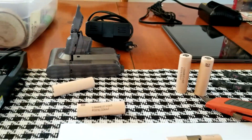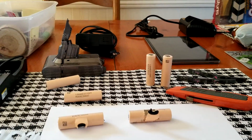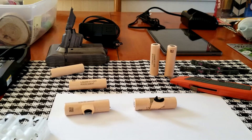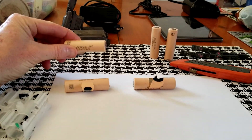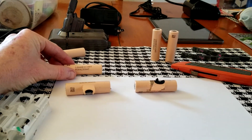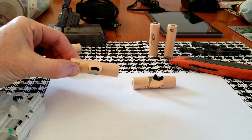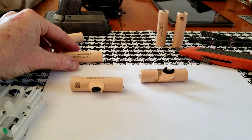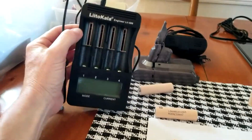The other four cells are looking absolutely fantastic — no visible damage. The reason people get rid of these packs, just like battery-powered tool packs, is they start to perform at 80% or 70%, or they just lose charge altogether, not being able to charge — meaning there is one or two bad cells in the bunch depending on how large your battery pack is. I'm going to do a little more research before I try to wrap these and put them on the charger.